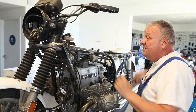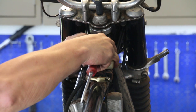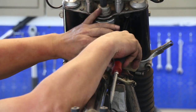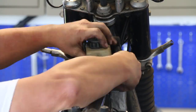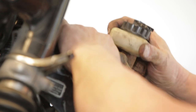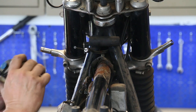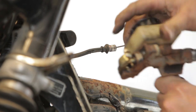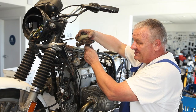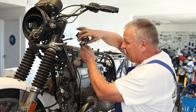Essentially the master cylinder is held in place with a hose clamp — it's not the original hose clamp, but it did the job. This is the brake light switch on these old models. Now we can just pull the cable through like that. Now it's essentially loose because we loosened that before, pretty easy to unscrew it now. This one doesn't have any fluid in it; if yours does, you want to suck the fluid out with a brake vacuum bleeder or something like that.